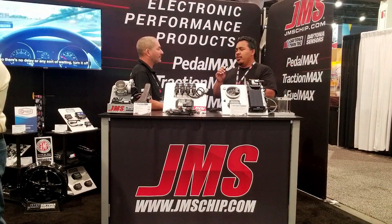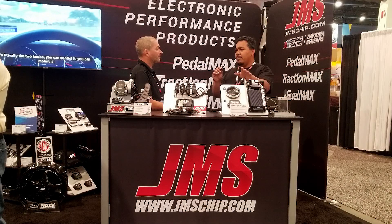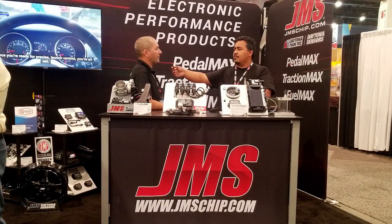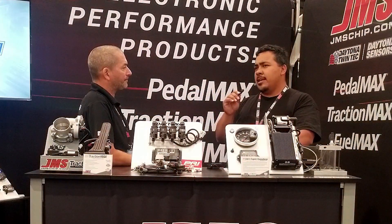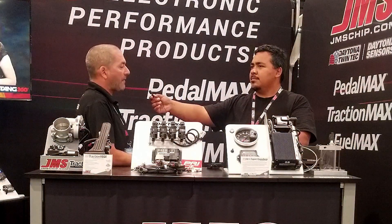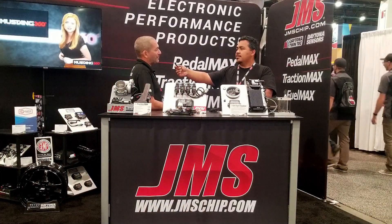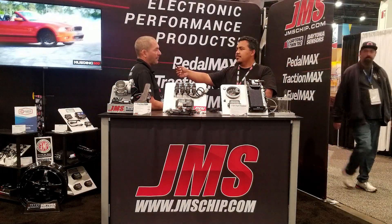I'm very familiar with your Wego units. Since I'm on E85 on my personal truck, I know you guys have something geared more toward E85 — on a different scale. We also offer our Wego widebands in a Lambda version for guys tuning with ethanol or E85. Will it work in flex fuel situations? Yes, absolutely. We have a version called the Wego 3D — you can hook up a Bosch-style flex fuel sensor to it, and it'll tell you your ethanol content. Then you flip the switch and go back to watching Lambda, so you know the ethanol content you're running at the time of your tuning.